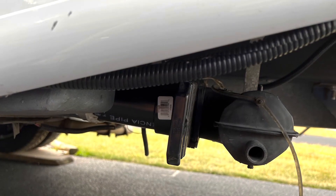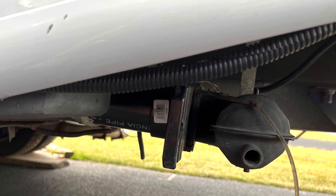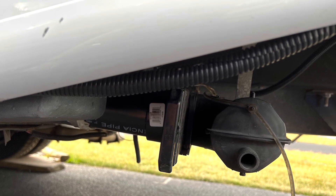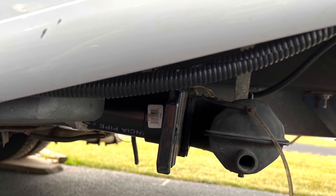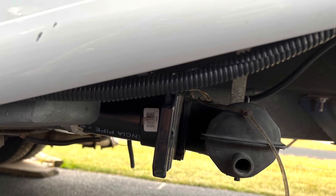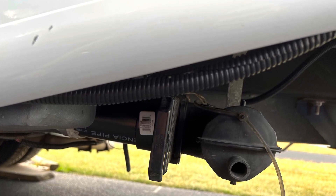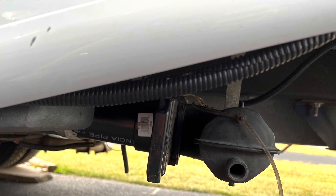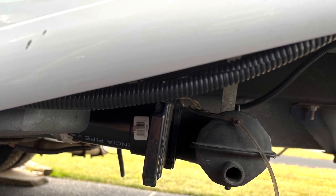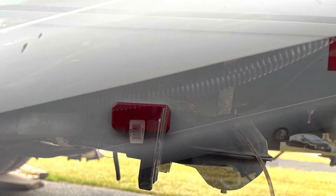On the black tank side — I apologize, I did not take step-by-step pictures of this side, but I can explain what I did. I took out the S-bend pipe and put in a short section of 3-inch pipe from the tank to the gate valve. I had to get a new flange for the gate valve since there was no way to get the old one off the S-bend, but I did reuse the gate valve and the elbow and put everything back together. Now it's just a short pipe from the black tank to the gate valve to the elbow. That raised everything up since I no longer have the S-bend making it go lower. I reused a support strap and had to shorten it as well since the connection is now higher.